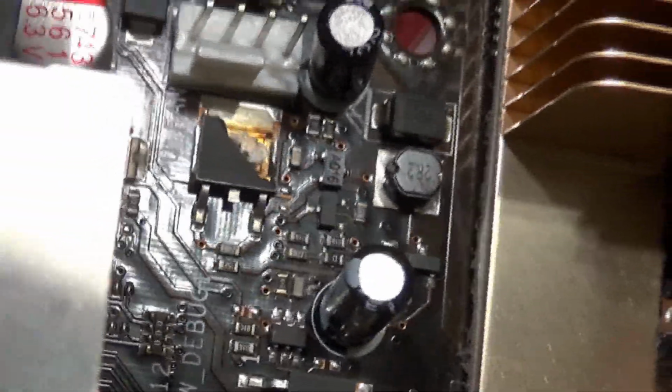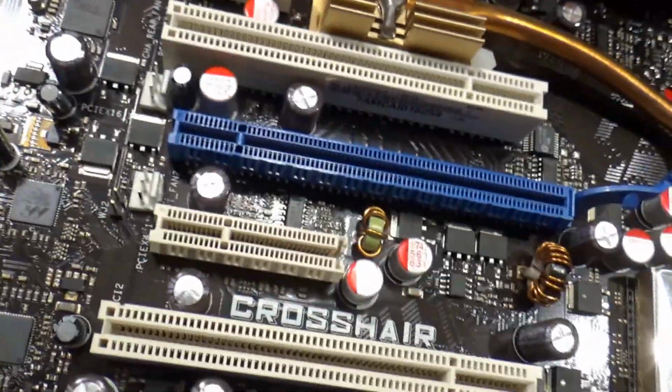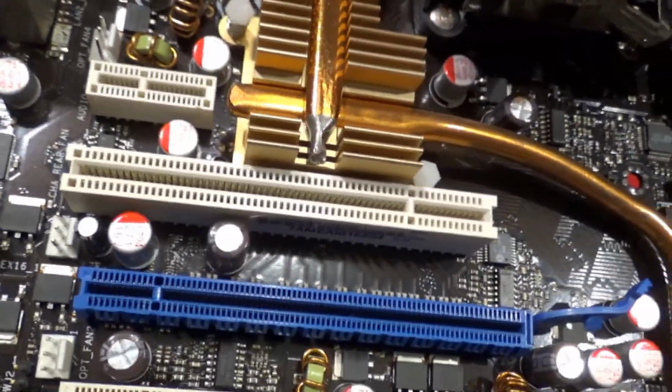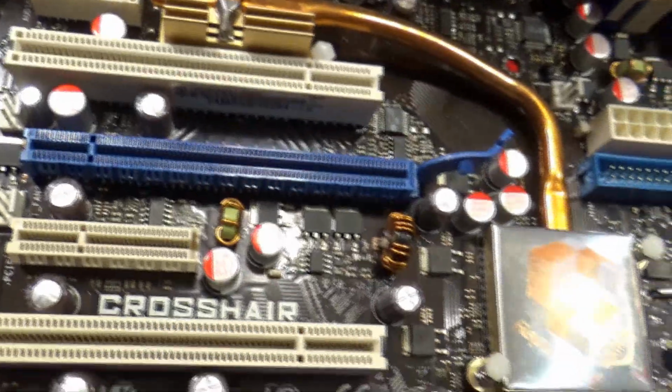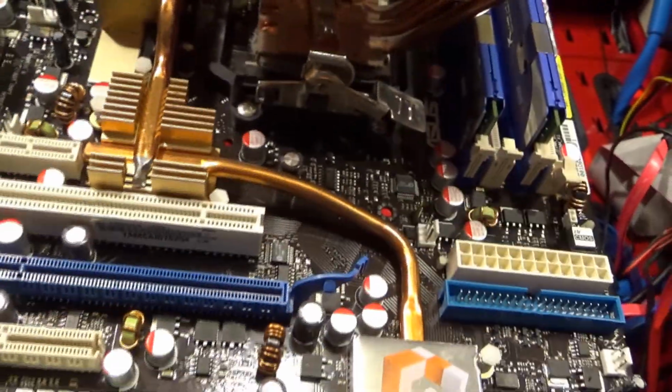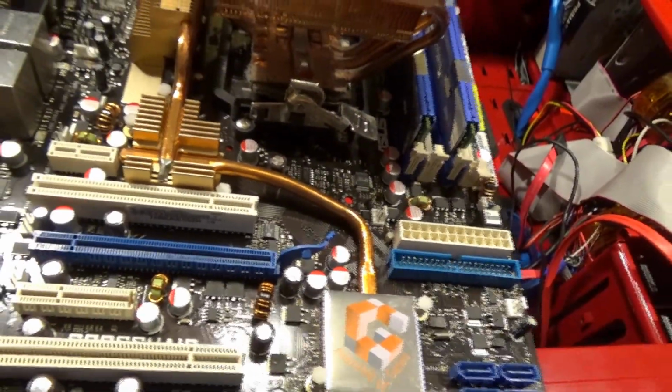There's just really no way I can replace that without knowing what it is exactly. Got no schematics or anything like that. And it's hard to know with that voltage regulator half melted away as to what else it may have damaged. But the last I knew was the CPU was working, the RAM was working. I'm guessing they still are fine.